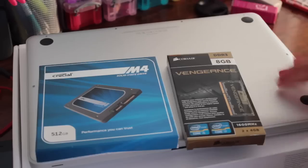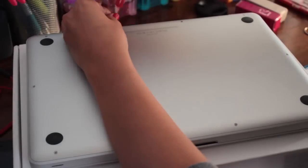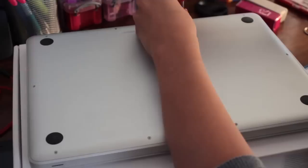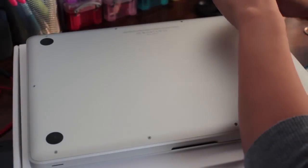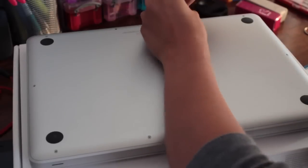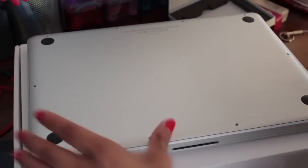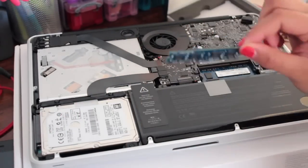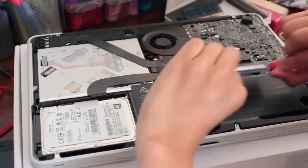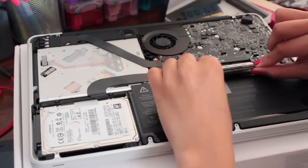So let's get on with the demo. I sped this up to save time. You're going to want to first remove the bottom of your MacBook using a small Phillips screwdriver. Be sure to remember that the top three screws on the right are a bit longer than the others. Next, peel off the lid and begin to take out the RAM — just press gently on the two clips on the side. The RAM will only fit into the slots a certain way, so you don't have to worry about putting it in incorrectly.